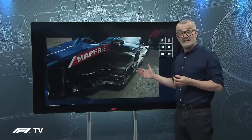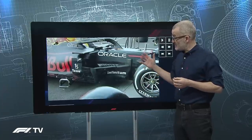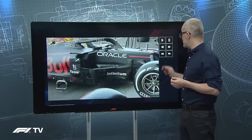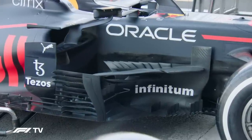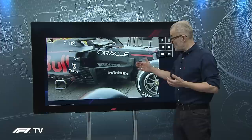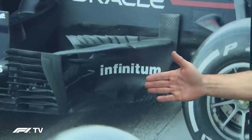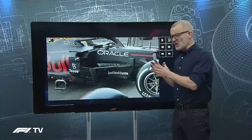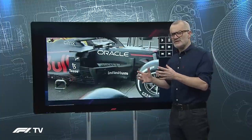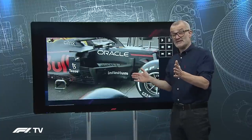They were introduced in the 80s and they're going to be finishing up at the end of this year — in fact at the end of this weekend when the checkered flag drops — and they've become increasingly complicated. What you can see now is an incredibly complex package of aerodynamic surfaces: a main board, a foot plate, upstanding vanes, boomerangs, and louvered sections. Lots going on, and they're all serving effectively two functions: to push airflow either down or out and around the car.